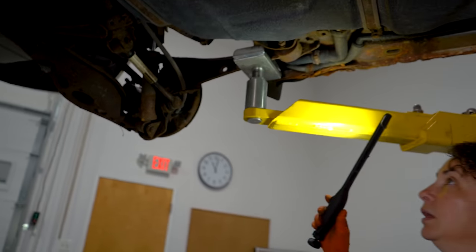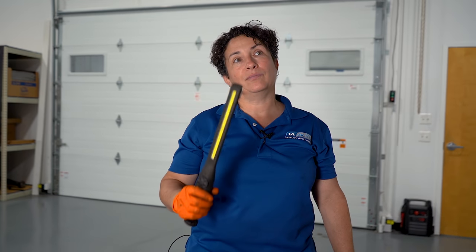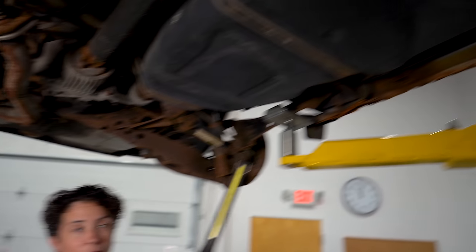You can see that there are two lines going to the rear, which tells me that each caliper cylinder has its own brake line. That means I'm going to do the right rear again and then the left rear. One, two, three, four — that's how I'm going to bleed these brakes.